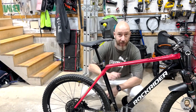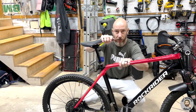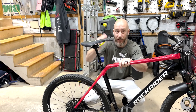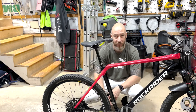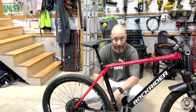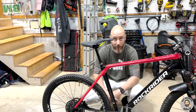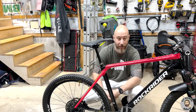With everything assembled, let's give it the test to see if the rattle is still there. Grab the saddle, give it a shake — wow, much much less. Hardly noticeable. There's still a little play, but there's always going to be some play in a dropper post. Guys, I think that might be solved. Obviously the true test will be out on the trail. Do I think electrical tape should be the procedure for a $300 dropper from a reputable company like PNW? No. At the end of the day it solved the problem, but I really think PNW needs to go back to the drawing board and come out with a recognized part — like a rubber sleeve to go over the cartridge.